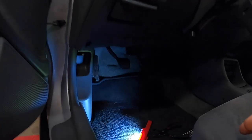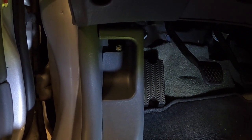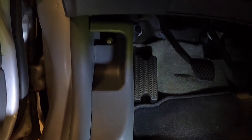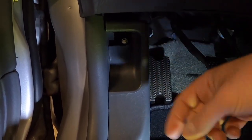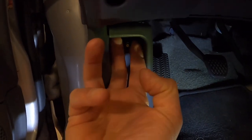Now that the passenger side door lock is fixed, I'm going to move on to the next item on the fix-it list, which is repairing this broken hood latch. When the car arrived here from Seattle, this was broken. It's a common problem with the EK Civics and probably other models. A lot of people assume this latch is on a hinge rather than a fixed cable — they go to pull it up and it ends up breaking off, when in fact you actually have to get behind it and pull it straight out.